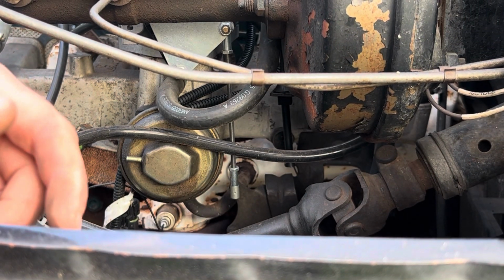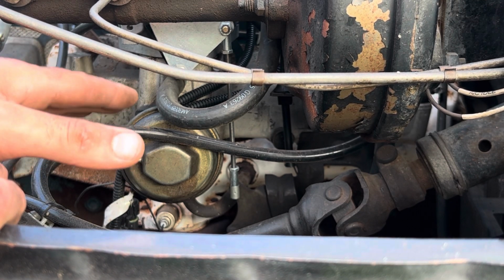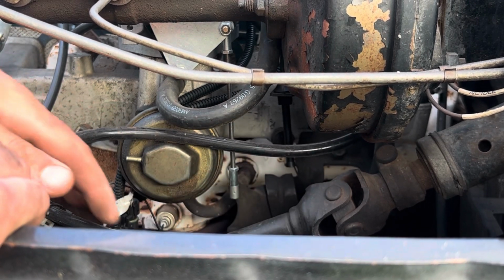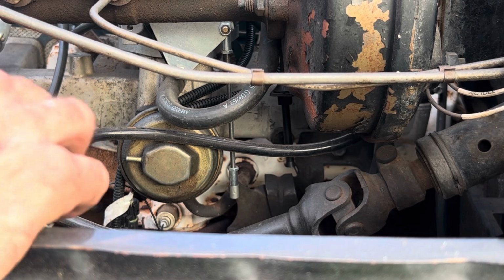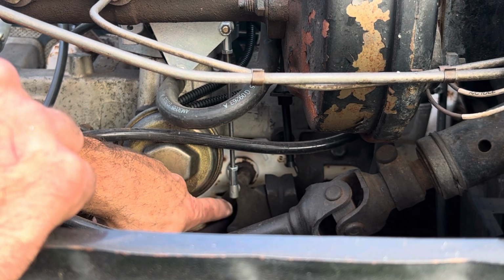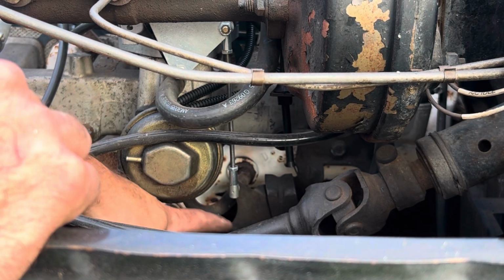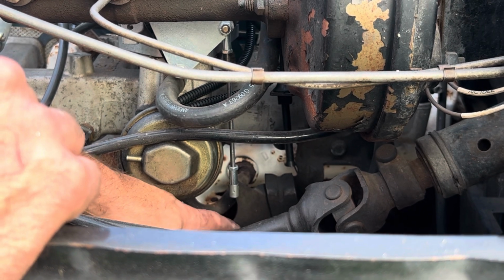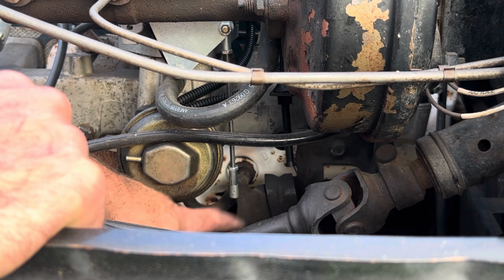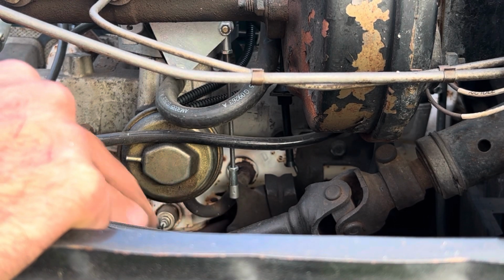Okay, now the last part of this that I want to talk about is the throttle hookup itself. This is extremely important. If you have an automatic transmission Jeep, you're going to want to keep the factory throttle swing arm set up like it was intended, because it has your kick down linkage, and it's very important you keep that functioning. All right, what I chose to do, I did not want to reinvent the wheel here. All this is a piece of threaded rod. I think it's like a 6-32 or an 8-32 threaded rod with a couple of the normal quick ball and socket style connections, and I just ran it from the factory throttle, where you hit the throttle and it will pull down. All right, and I ran that up to the fuel injection, so that as I actuate the throttle via the cable in the back here, it pulls down on the fuel injection and it clears everything nicely, and there's really no issues beyond that.